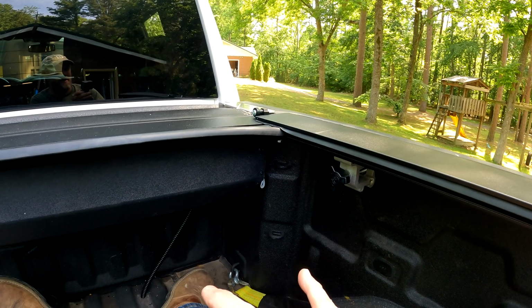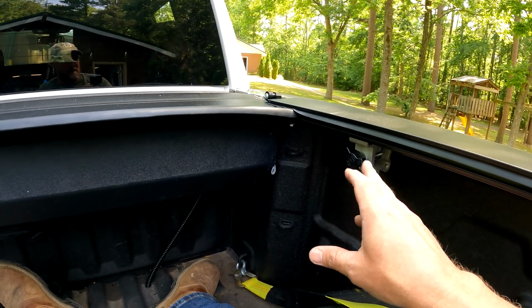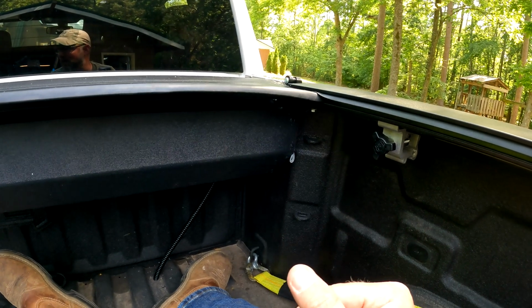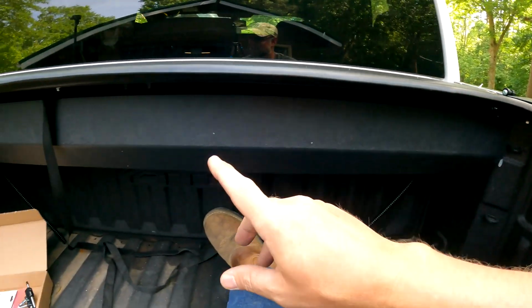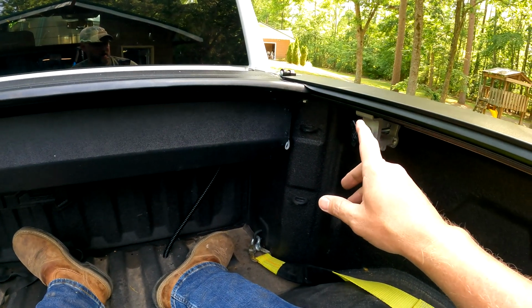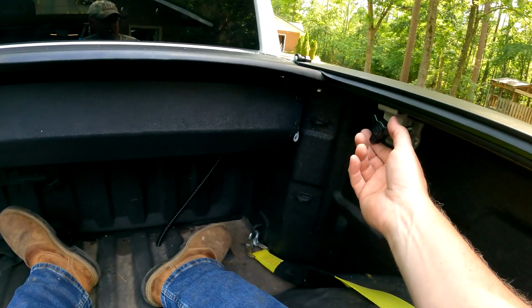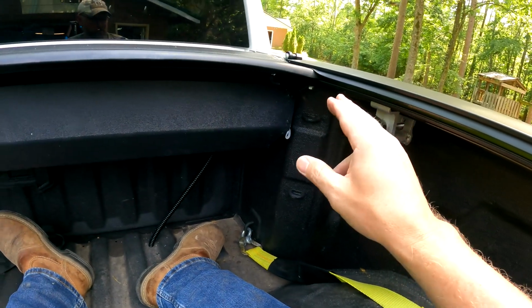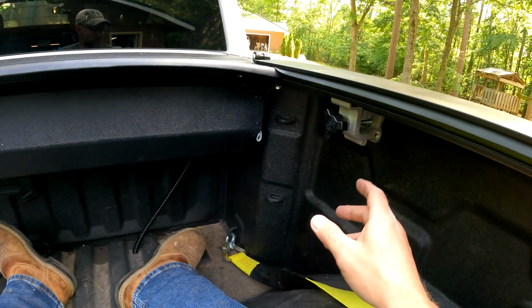Also, I would recommend starting with your distances at the front, get these tight, and then work your way back. I got these bolts tightened first, and that kind of held a little bit of a set distance, and then I have one set of extra shims on each side, and then I tighten these things down real good. I'm exactly 58 9/16, which is what the instructions want you to be.